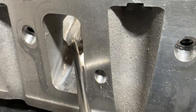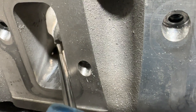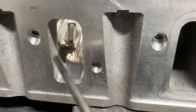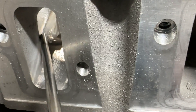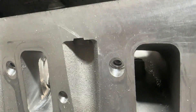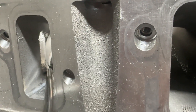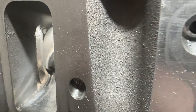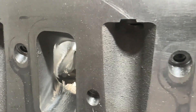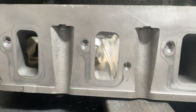Now I'm going to work this side. You might say, why don't you do the whole thing like you did over here? I won't, because I'm going to switch to a different view to do that. The only thing I'm going to do right here is take out this rocker stud boss right there — that's actually where your rocker arm is. I'm going to knock that off, and that's the last thing I'm going to do on this side. I won't even touch here because I'm going to flip it around to do that view. This right there is where that bulge was. There's a little hole right there because this is where that rocker boss is going to go through — there's going to be a hole there that will eventually get opened up. Now I'm going to flip it over to do it the other way, because this is face down. That's when I start the most important part.